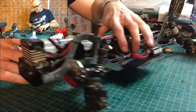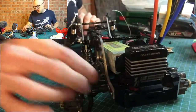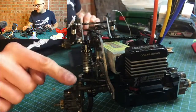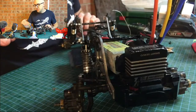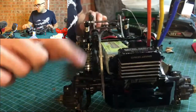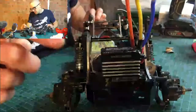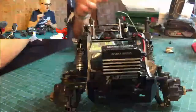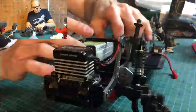And by fixing that steering link, that drag rod, it hasn't affected the effective length of it or the geometry of it. All it's done is change the rods, which changes what the angle is perceived to be, but because the two points haven't changed, they're fine. So actually I'm a bit lower down than I was previously, which is fantastic, suspension wise. And yeah, this thing's going to be super low.